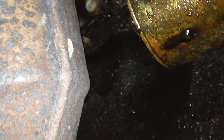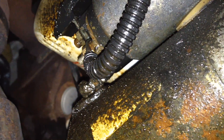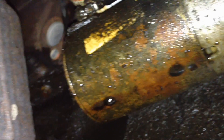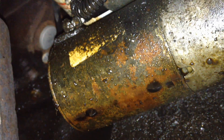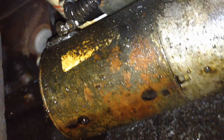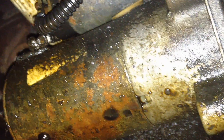The oil pan is also suspect — it's real common on these. You can see it's actually leaking. But it's not just the oil pan; doing an oil change and loosening that filter, or a leaky oil filter as in this case, is the main culprit. Every time this thing gets an oil change, the starter gets an oil bath. It's a horrible design — I see it all the time with intermittent no-cranks and slow cranks due to the brushes wearing out. We're going to change it out and fix the oil filter leak for this customer, then move on to a separate misfire diagnosis.